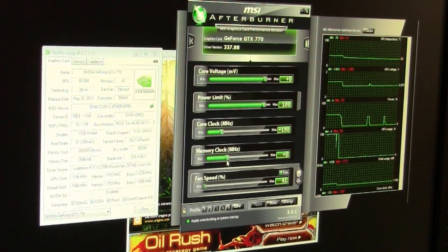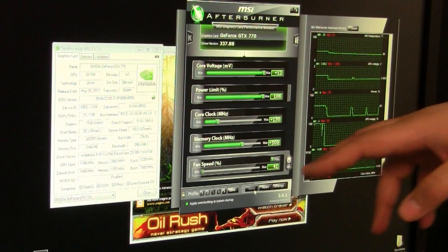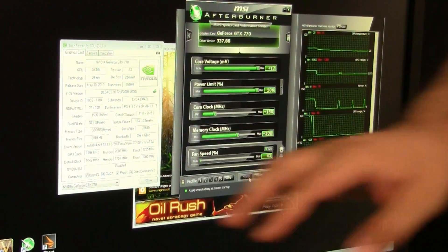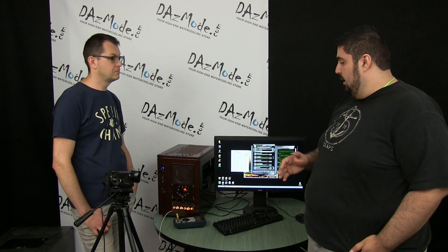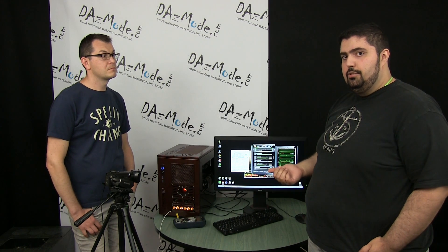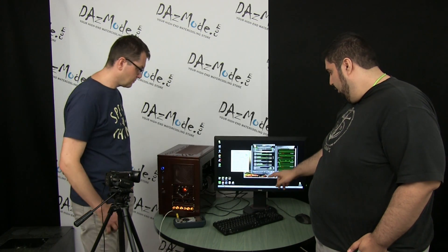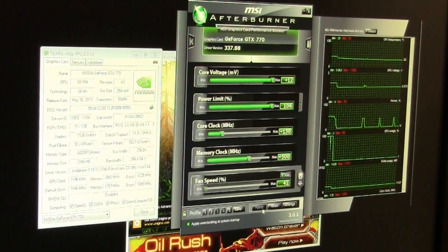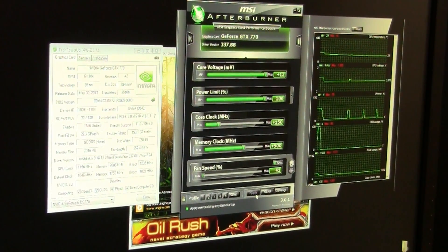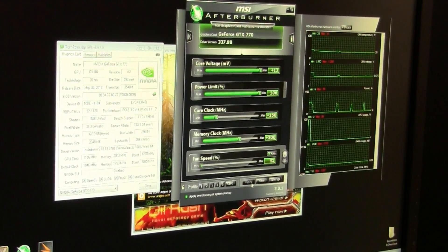The memory clock works the same way. I found the sweet spot to be plus 500 MHz. Memory speeds are a little tricky: according to GPU-Z, stock is 1750 MHz. Since it runs at a DDR rate, it's double-pumped to 3500 MHz. GDDR5 is the memory these graphics cards use — double-pumped that becomes 7 GHz. So 3500 MHz default plus 500 MHz offset gets to 4000 MHz; double-pump that with GDDR5 and you get 8 GHz effective memory clock. Whatever number you see, multiply by four to get the actual clock.